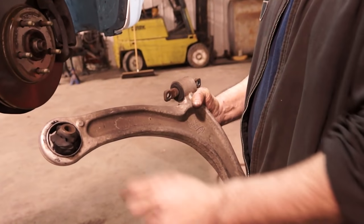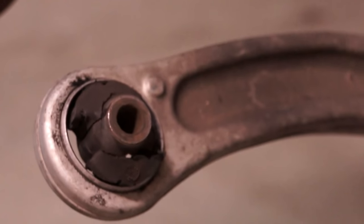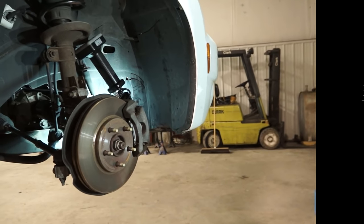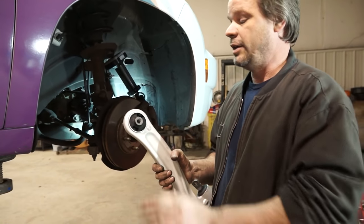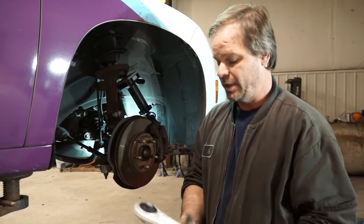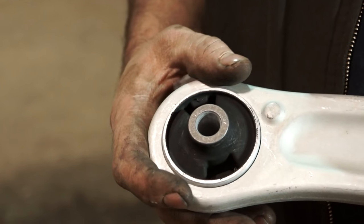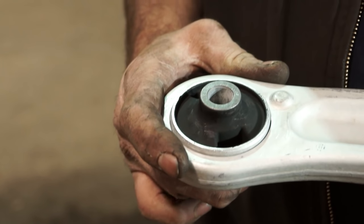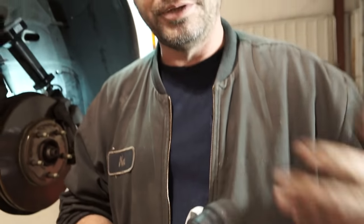You can see there's your damaged bushing — ripped right out of it. There's our new control arm with the good bushing installed. Now you can replace just the bushing, but the problem is you have to have something that fits the ring perfectly to press it out and press the other one in. Another reason we're doing the whole thing is you get a new bushing, new bushing, and a new ball joint all in one. If you were to pay somebody to replace all that stuff on your old one, you'd probably end up spending more than what the whole control arm costs brand new.